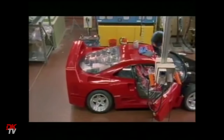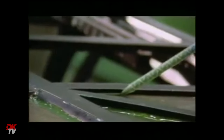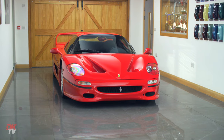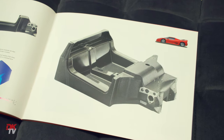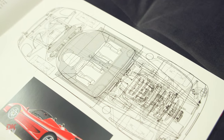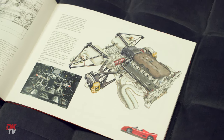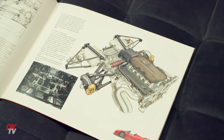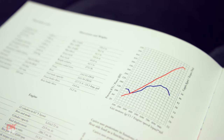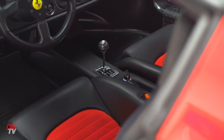It was a very different car to the F40. Unlike the F40 that was a steel frame wrapped in carbon Kevlar to stiffen it, with a twin turbo V8 and a manual gearbox, this was the first Ferrari with an all carbon fibre tub. It had lightweight aluminium suspension, unequal length wishbones at the front, and push rod suspension. The engine was mated to the tub - a 4.7 litre V12 producing just over 500 horsepower, derived from the 1990 641 F1 Ferrari - a race-derived engine detuned, revving up to close to 9,000 revs at peak power, mated to a six-speed manual gearbox at the back.